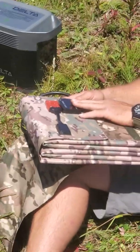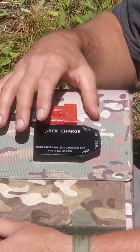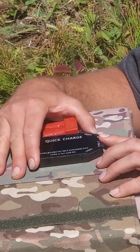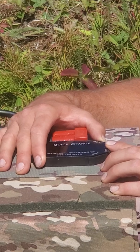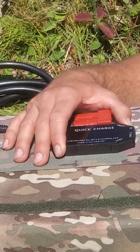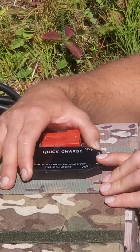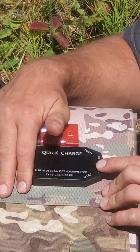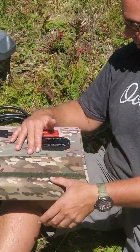The other thing we have here is our quick charge module, which includes two high speed USB charging ports and a USB Type-C PD. What that does is charge any of the newer iPads, new iPhones, a lot of the newer laptops, even my Samsung Galaxy S10 Plus, which charges from USB-C as well. This basically future-proofs yourself because it will be the new industry standard. There is also a digital display that, when it is charging, shows you your wattage.